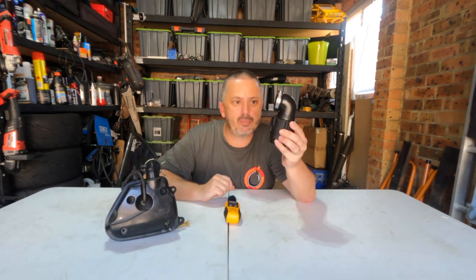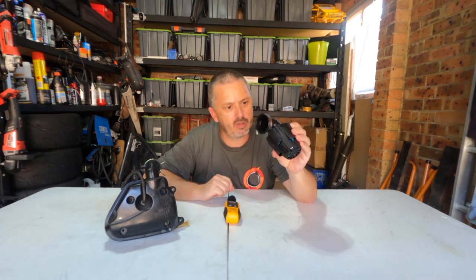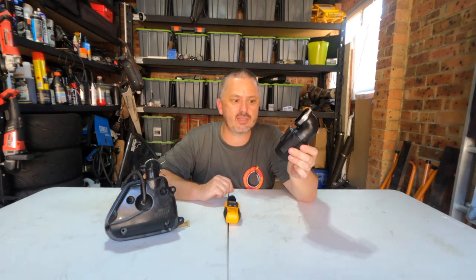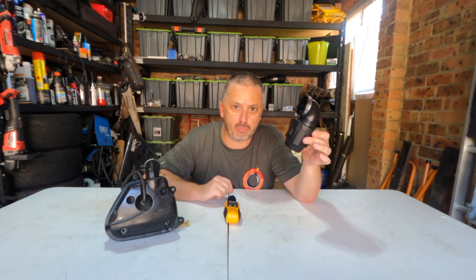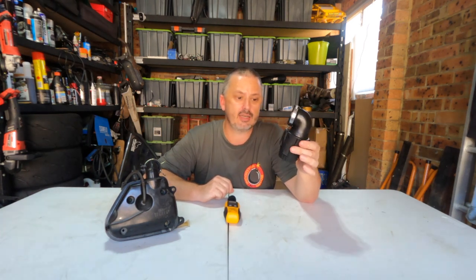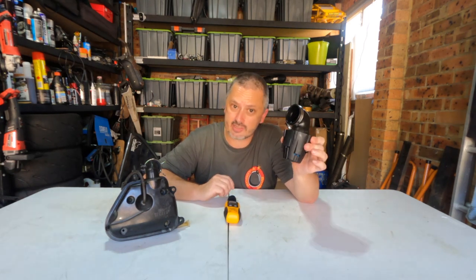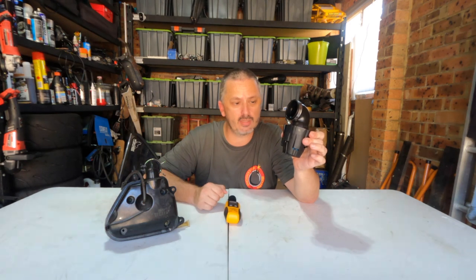And that's why most people go for the pod filter. It virtually has no restriction. It can suck as much air as it can get, and definitely more air than you can put in a 70cc cylinder. So it is perfect for your 70cc kit, whichever one it was.